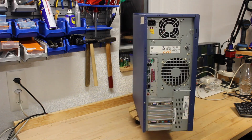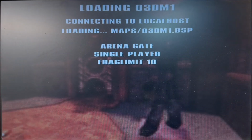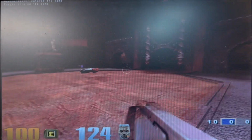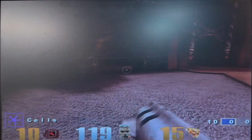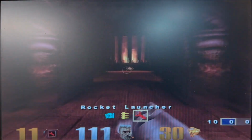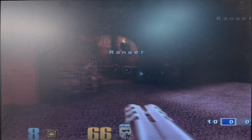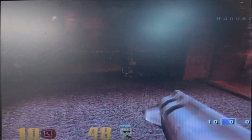It's just that the SGI 230, with its VIA Apollo powered mainboard, the 733 MHz Pentium 3 and the Nvidia Quadro, albeit a less advanced graphics card than the later GeForce 2 Ti, brings an overall improvement of plus 12 frames per second. Now, Quake 3 Arena was known to strongly benefit from a faster frontside bus, and the SGI 230, featuring more recent gear except for the graphics card, would actually have made as good a gaming rig for my contemporary needs.